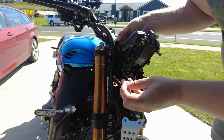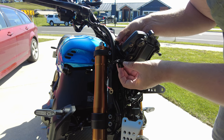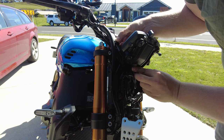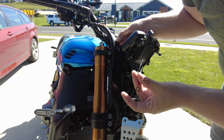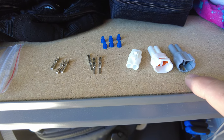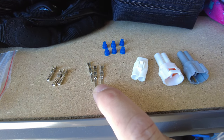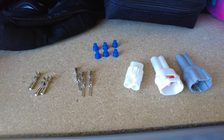I'm going to try and splice that connector onto the end here, so I'll take these wires and connectors off. I am going to leave the built-in fuse, just because I don't know what level it's fused to. The key thing is that it will reach down to where it's tucked in down here; otherwise I'd have to add extended wires to this, but I think it's going to be okay. I think I can use these pins along with the grommets in the back to make it watertight, so it's all sealed and good.